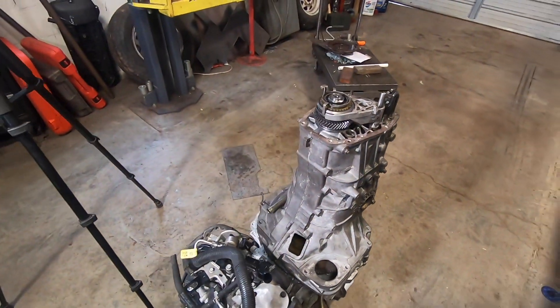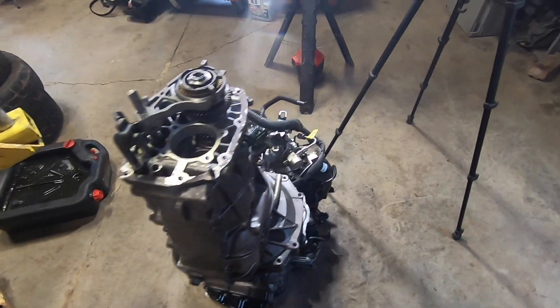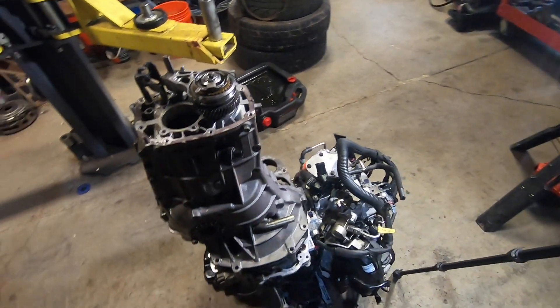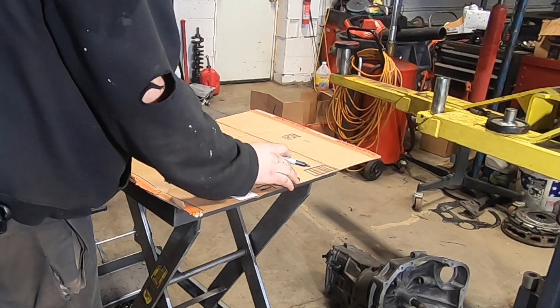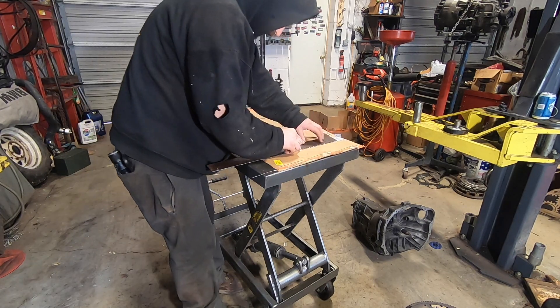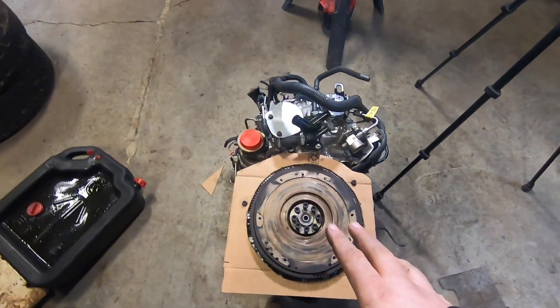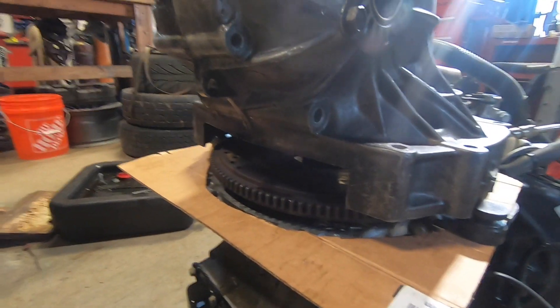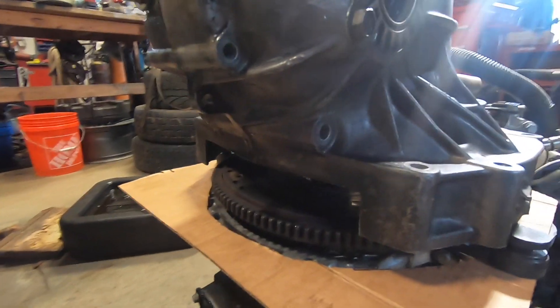I definitely need to do a little value engineering on the design of this, because if I make that out of aluminum it's probably going to be a six hundred dollar piece before machining. So let's draw this up and see where she takes me. I can already tell I'm going to have a lot of gaps to fill here. None of this is critical support area, but I don't want rocks to get in there. I'll have to build some stuff in there — certainly along here my plate will come up, but then there's this whole gap. I wonder what Subaru does there — do they have a plate over that or just leave it open?